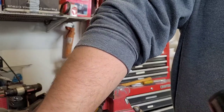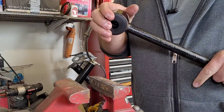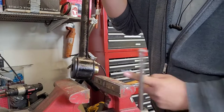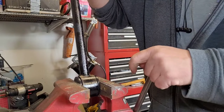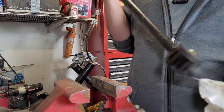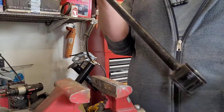The grease they give you is very specific to the polyurethane bushings and it's kind of sticky. That one almost goes right in. Always grease the holes, guys — always grease them. So that's that. Bushings are pressed in. I'm going to go with a little bit more paint in these places because my old can was empty, and then we'll go put this back on the car.